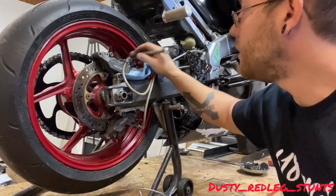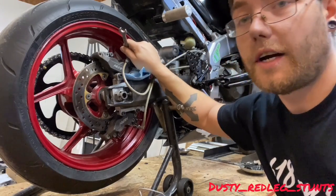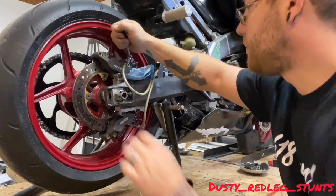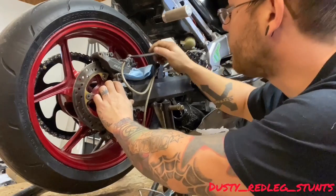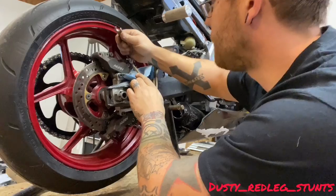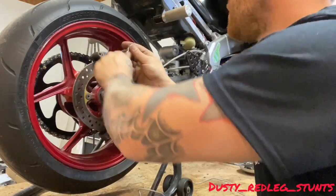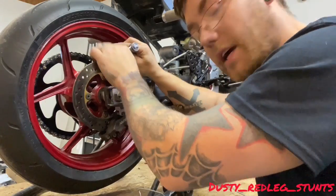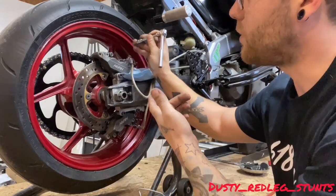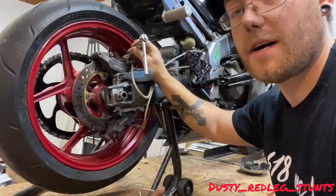Some people's are different — mine's a 12, a lot of them are 14s. I don't know why they're different, it really doesn't matter. I'm gonna break this loose because I can't get to mine without it, and I'm gonna tighten it back up so I don't get a bunch of air in there. Now I'm gonna take the pads off. Some calipers you need to remove the whole caliper, but these F4i calipers you do not — you can just unbolt them at the top and slide them out.